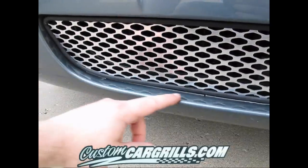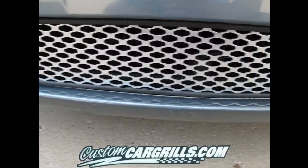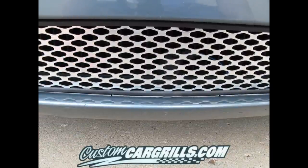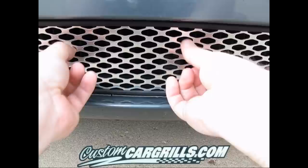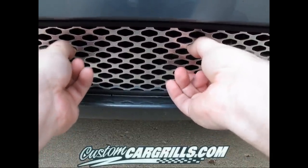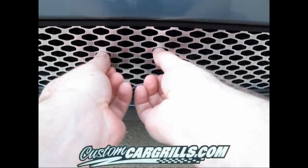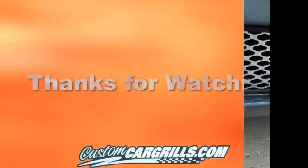As I mentioned before, usually I like to do the tape all in one continuous piece — you'll see there's a gap there as a result of this install. But let's go ahead and give it a test here — make sure it doesn't come off. This is the most important part; you want to make sure it's securely on. I'm really yanking on this thing — you can see the bumper moving — and it's on there securely. You want to make sure this is on very solid. This is one of the installs where there really isn't much of a backup plan where it's attached to the vehicle with a screw or a cable tie or wire. So safety is first when you're doing this kind of installation.